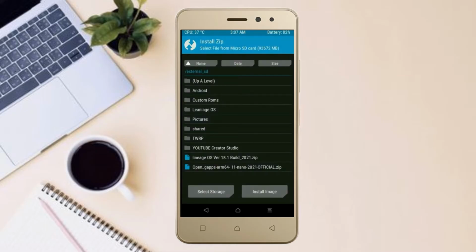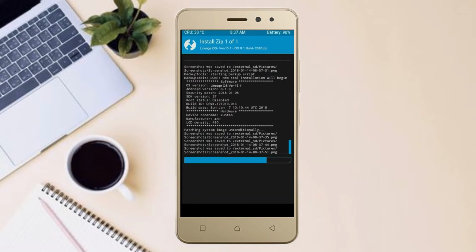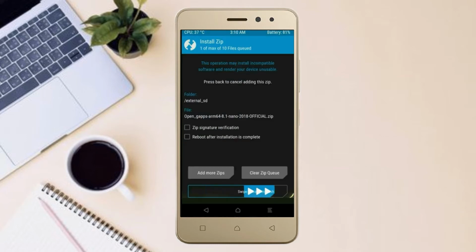Select Android 11. Friends, here I have provided the latest version of the custom ROM and gapps which are suitable for your device. Please find them in the description below and you may download them. After selecting this Android 11 ROM, swipe right to install. Click on back. Select gapps. After selecting this, swipe right to install.